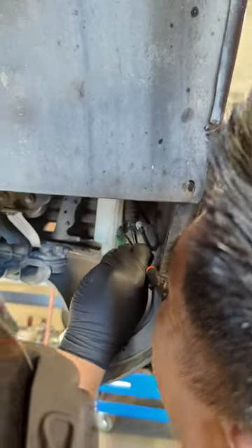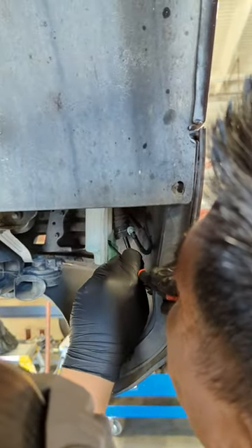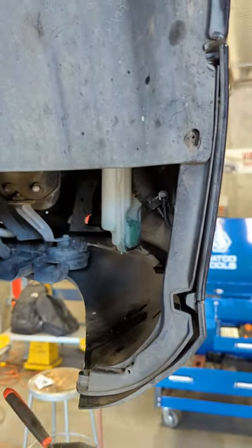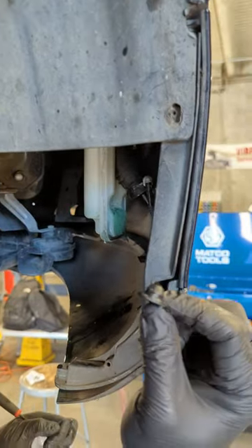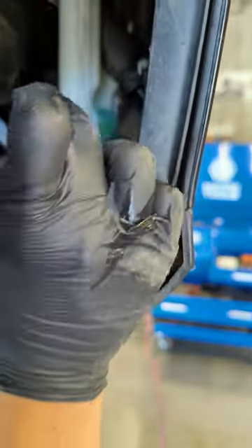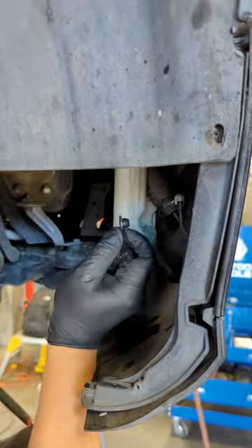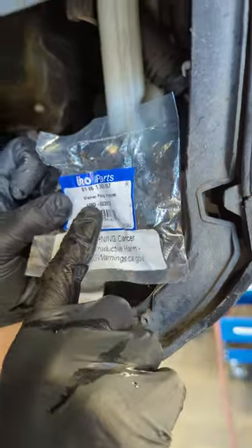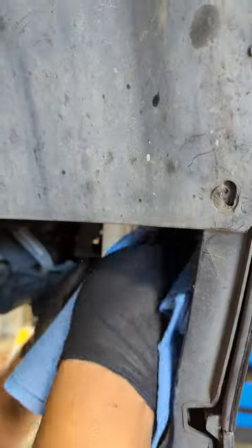Before we take the new pump and put it on, there's a little o-ring grommet sitting in the tank, and we need to remove that. So here I'm just taking a pick and we're going to fish it out. The grommet itself might be the source of the leak, so it's safer to just replace it. We're also going to replace the other one on the sensor as well. If you want that part number for the grommet, it's here and also in the description below.